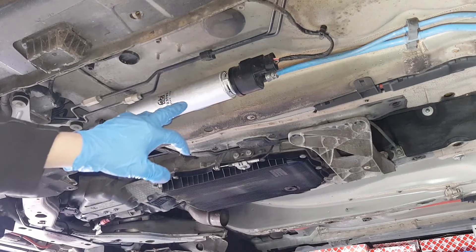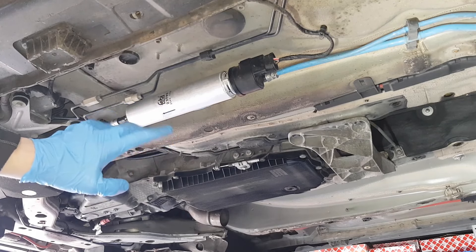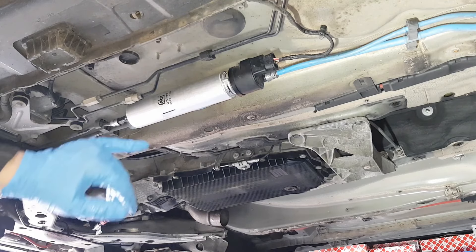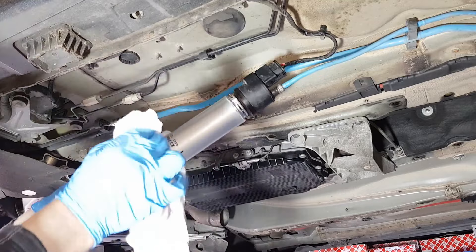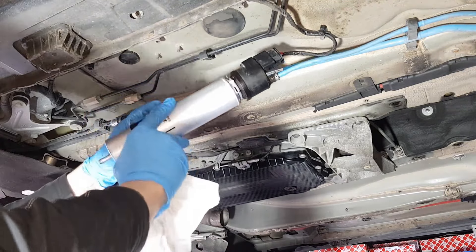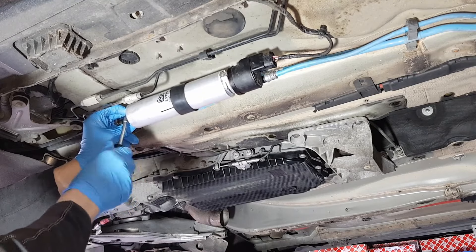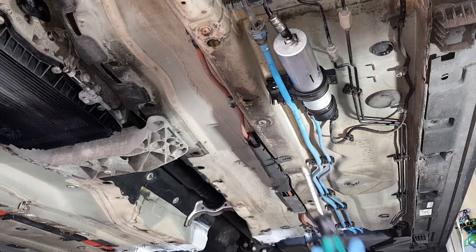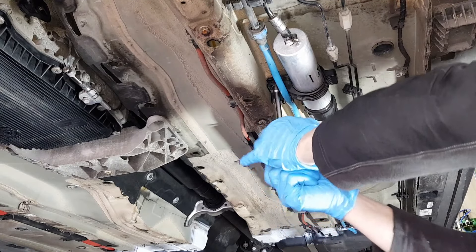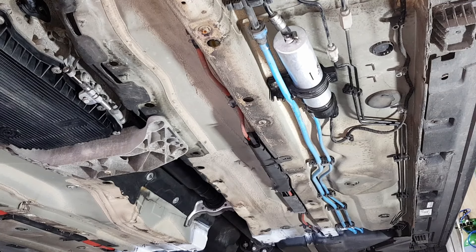The critical moment here is not to start the engine without priming the system. You want to run the fuel pump for three minutes. The system runs it at three minutes at about 4.4 bar. Don't forget to replace the rubber on the filter housing and assemble the clamp the way you took it off. Install the 10mm nut. Run the diagnostics and prime the fuel pump — I'm going to show you exactly how to do this in the next step. I've screen recorded it for your convenience.